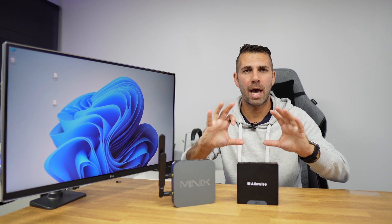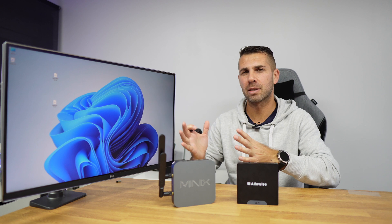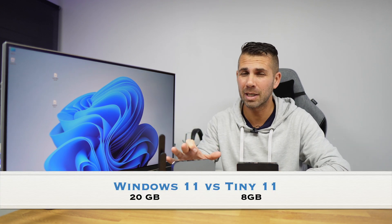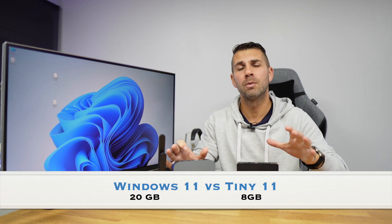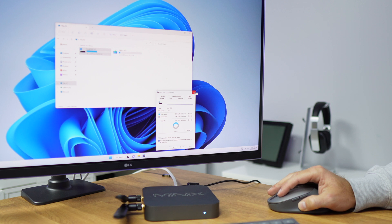As a note on the main differences: a normal Windows 11 installation takes about 20 gigabytes of storage, while here it only takes about 8 gigabytes. In my testing I got roughly 13 gigabytes of usage — so not 8, not 20, around 13. There are no system requirements, so if your machine has only one gigabyte of RAM, you will still be able to use Windows 11 with everything available.